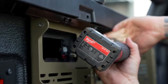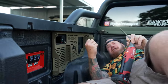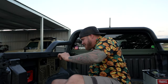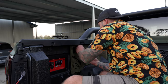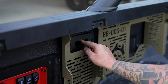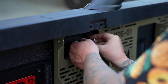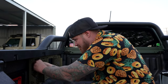Draw these ones up nice and tight. Watch your fingers — you hate when you pinch your finger. PPE, people! So we'll do the opposite of me. We've got our plate — the wiring plate we spoke about earlier — put our two bolts in, bring our wire out through one of the larger holes. Put our plate in. When your sparky wires this in, you'll be able to put rubber grommets in these holes which will stop the wires chafing and wearing through, so your wiring is nice and protected.